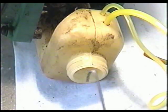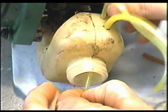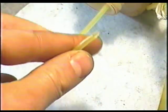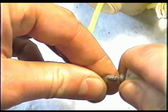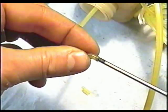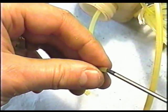Once you've got 2 to 3 inches in there, retrieve it with your wire again. If you pull on it on this end, it's going to go in good. Now with your side cutters, cut the tip flat as well. I've got another filter from another weed eater. Insert your filter in there — you may want to spray it with liquid wrench or a bit of oil to make it easier. If you still find it hard after lubricating, grab a small screwdriver, insert it in the tip, and turn it around in the fuel line to expand the tip and make it easier to put the filter in.